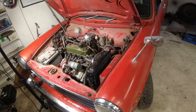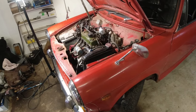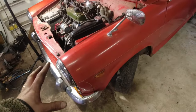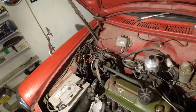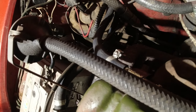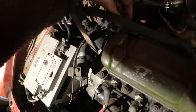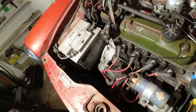The brakes felt overly warm — the drums were a little bit warmer. But I also pulled the parking brake a couple times just to try and clean the insides of them, so next time I drive that should be no issue. Did a couple hard stops. Calipers up front — everything seems to be working well. I noticed one thing: there's a little bit of smoke coming up right there — that's the heater hose, it's leaking a little bit right there. I used the original style clamp just because they look good, but I'll put a modern style clamp on there as well because this one is bottomed out and feels a little loose.